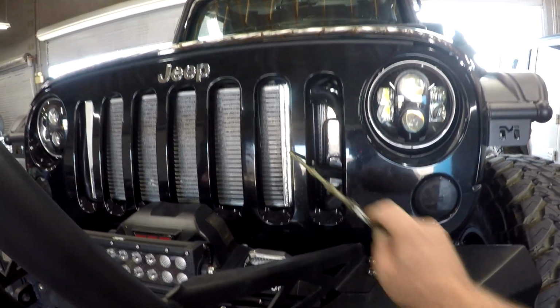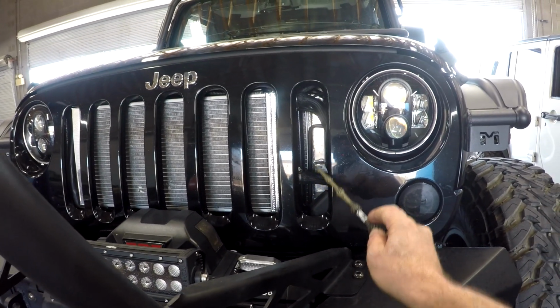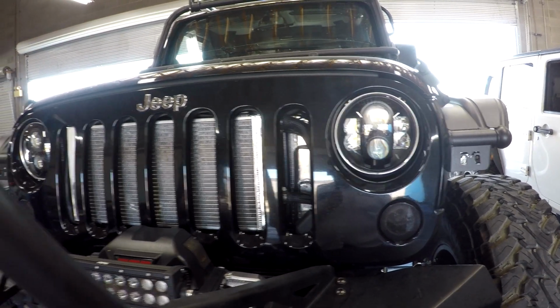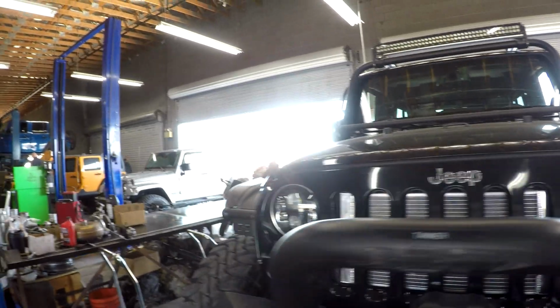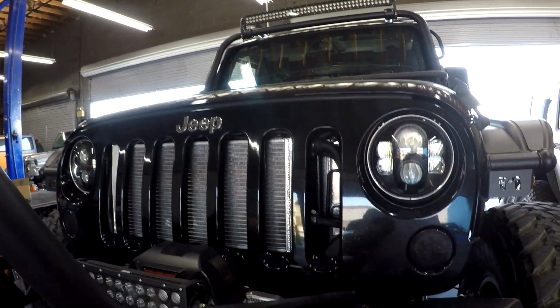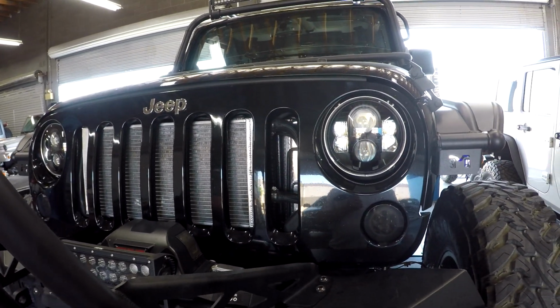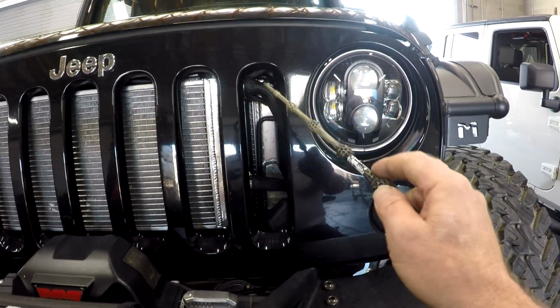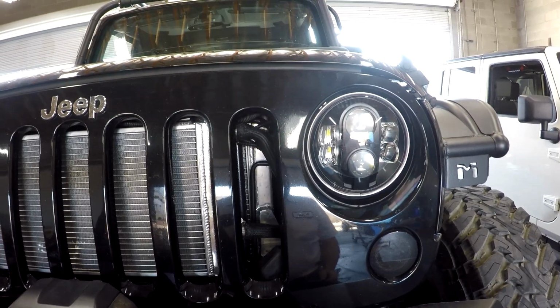So this is our intercooler, and it's water to air, obviously. This carries the cooling water back into the intake where there's a heat exchanger. That vehicle has the same setup. And that's a lot more compact than an air-to-air intercooler, meaning you have like a giant 4-inch pipe coming in here, and it's also more efficient.